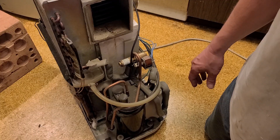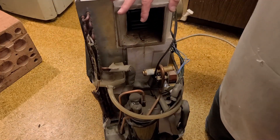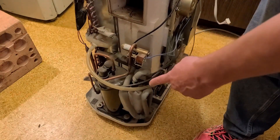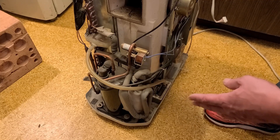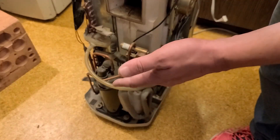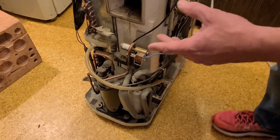Surprisingly they're using a Toshiba compressor motor — that's actually a name-brand good compressor motor. This long tube that looks kind of like a tank right down there is known as the receiver dryer, found in all air conditioning systems including your car. As the fluid goes through, this is literally filled with silica gel — those little 'do not eat' packets that come with electronics. It ensures there is no water in the system at all.